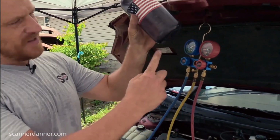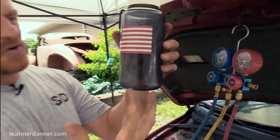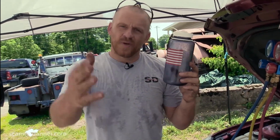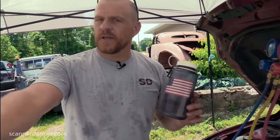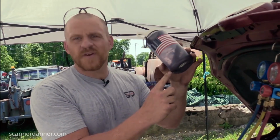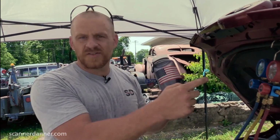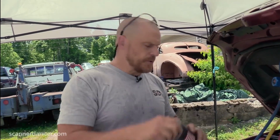You notice I left just a little bit of liquid in the bottom of this, right? We still have a container right now where my pressure and temperature relationship would still hold true. So what I'm telling you guys is this first step does not tell us if our system is fully charged. It only tells us that there is some liquid refrigerant still left in our system because our pressure and temperature will be matching. The pressure temperature relationship will be holding true.